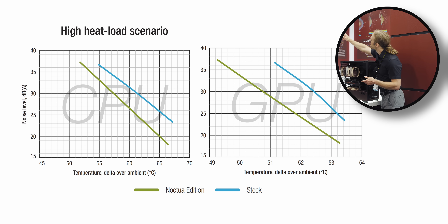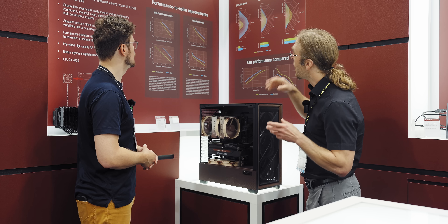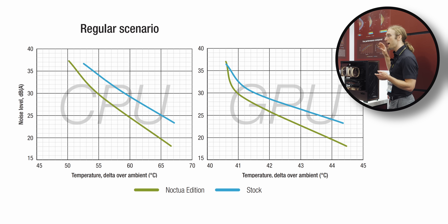On the CPU, the benefits are especially high in the lower RPM ranges — around 6 dB noise reduction at the same CPU temperature. One thing we found is that the Flux Pro is already a very high airflow case. If you have less heat load inside the case, like in our regular scenario when we kept the 4090 at 450W, you can see the lines converging towards the lower RPM range. At a certain level you reach a thermal saturation point, where the intake air temperature for both the CPU cooler and GPU cooler is the same as ambient air. At that point, increasing airflow at the same noise level doesn't give you any benefits anymore.